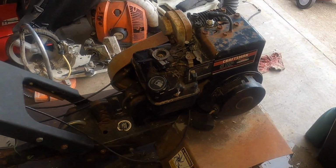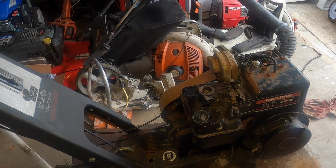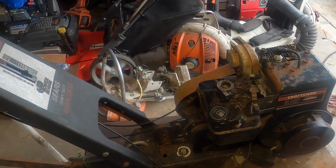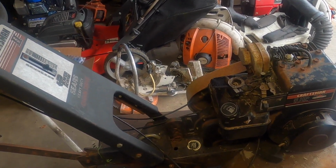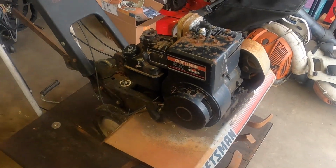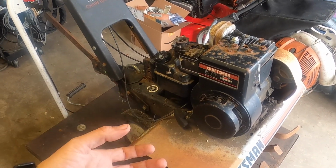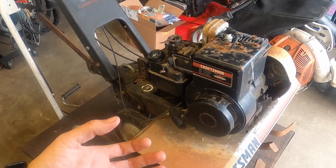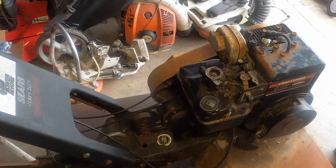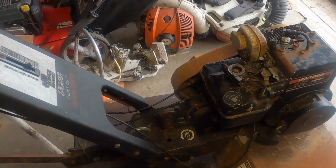But anyway, there's a big difference between, I don't want to say drag, but like if it's hard to pull over, maybe the belt's engaged, maybe it's a chipper and just has a big heavy piece on the end. There's a big difference between heavy to pull and hard to pull and no compression. You'll feel like one hard area, and that's, I know, get it, but I don't feel that here.